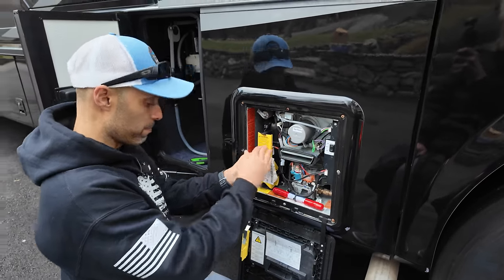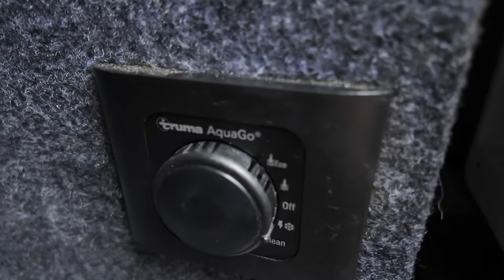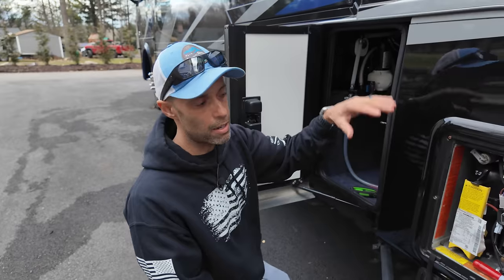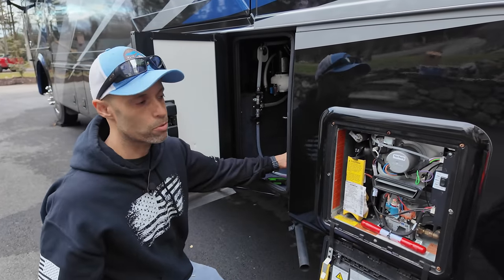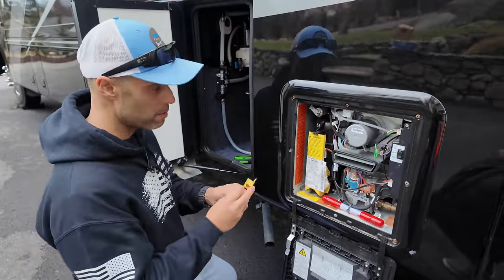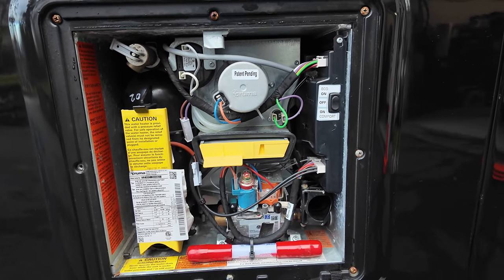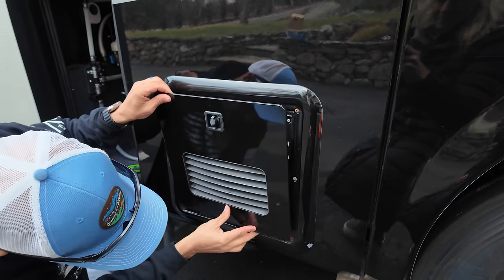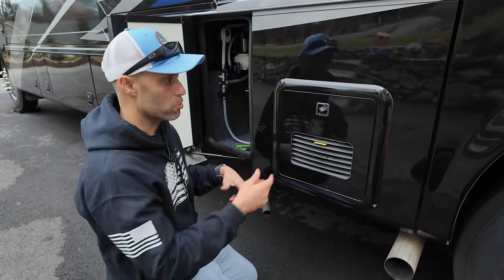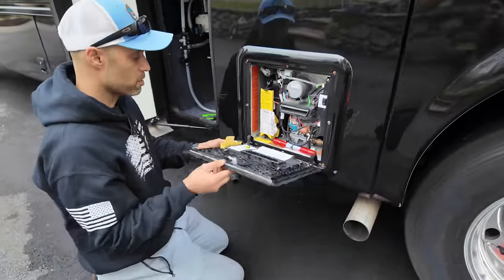Now I'll show you the final step, which is on your controller. The Truma has a controller — you have eco mode, off, comfort mode, clean mode, and then of course the antifreeze mode. You will put it in antifreeze mode to keep this activated. If you buy this as a factory option, the controller will probably be somewhere inside. Since ours was done aftermarket, it was easier to put the controller here. When you're going down the road and not running the system, this cover goes inside here, and when you close it up, that little yellow fin will stick out. Remember: when you want to run the system for hot water, you have to take this out. If you don't take this out, you're going to get an error code. So you come outside, open it up, pull it out, put it in the holder, then turn the system on and you're good to go.